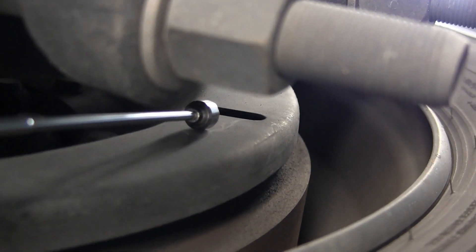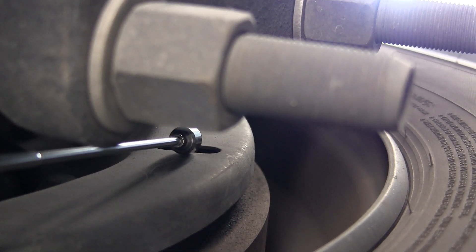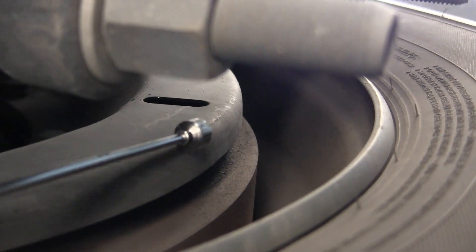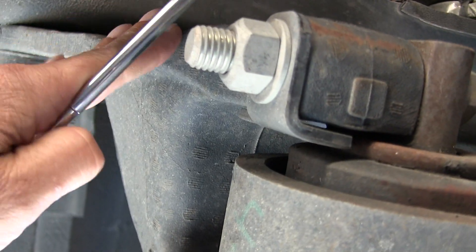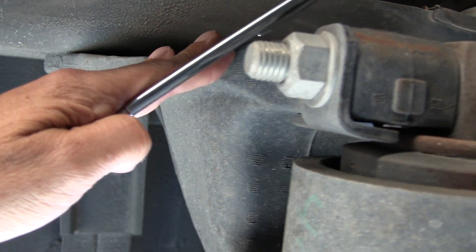On the passenger side, here is a sight window for the brake linings, which are not too thin. Also the brake drum, which is on the outside, is also not too thin. Then we will talk about the suspension. This right here is the control arm spring mount — it's not cracked, damaged, security mounted.